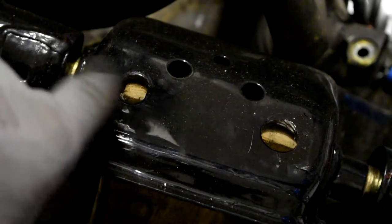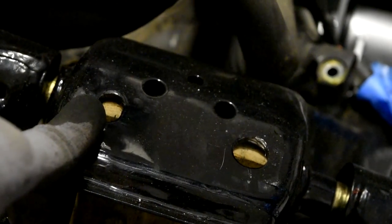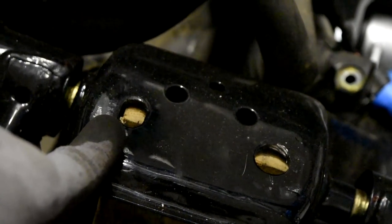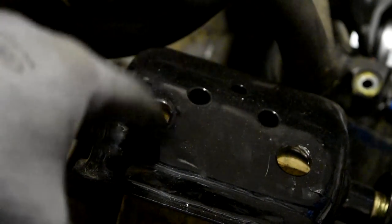What ended up happening is right here, the rings on the actual coilover ended up impacting right here, which is obviously a problem. Hopefully once I get the bolts properly mounted all the way, I won't run into that problem anymore. Some people have done some weird, crazy things to get it to fit. Some people have actually gone and cut this out and then added a support beam that goes through here to here — it's like a hoop. I'm not exactly sure where to find that, so if anyone knows, please tell me.